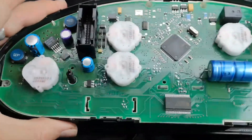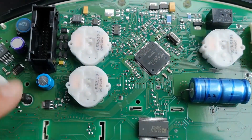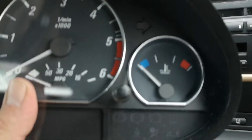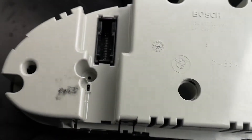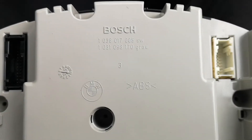When you're dropping in this main circuit board, you have to have these both in the horizontal position — when you do it, it'll sit flush. Otherwise these are not sitting correctly. So, make sure they're horizontal and then you can hold that, just double check it, make sure your bits line up — they're just like inserts inside there. Then you're okay to put the rest back together. When you're putting the plastic cover back on, those same two little black bits — make sure they line up each side. Then that sits in and they're secured, giving them an anchor point and keeping the tension on the spring.